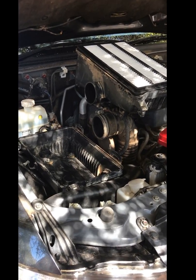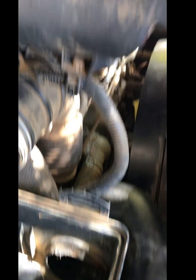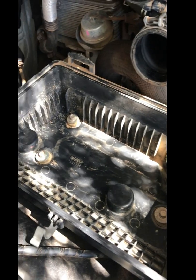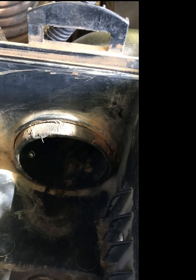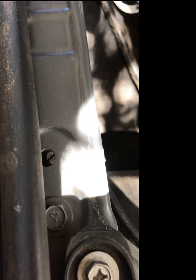The assembly is apart, except I still haven't removed the bottom part of the air filter assembly. There are three bolts to remove, and one little gotcha — there are two little plastic clips at the rear and two little tongues on the top part of the assembly that you have to unclick and click back in when reassembling. With a snorkel fitted there's a rubber connection underneath, and I can stick a screwdriver through a hole to release the bracket screw and pull it all out.